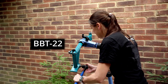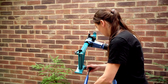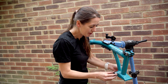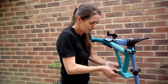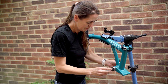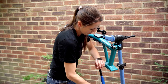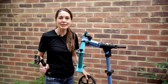Now I think I need a tool. I'm using a BBT22 — it's a 22 spline tool. Now I'm going to do the final tighten and I can see there's no gap between the bottom bracket and the frame. Now I'm going to do the non-drive side, remembering that this does up the right way — righty tighty. I can start by hand but it suddenly becomes too difficult, so I need a tool. It's really nice and flush with the frame.